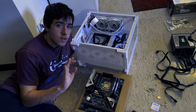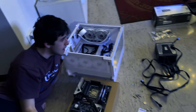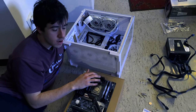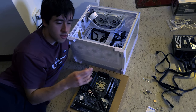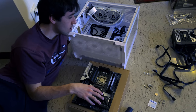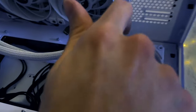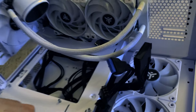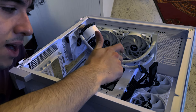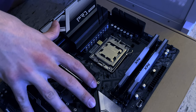Okay guys, so we don't have good news. What happened is, as you can see, we dismounted the whole PC and I tested with another power supply because I thought, okay, maybe it was just the power supply that's broken, but when I first turned it on, the motherboard flashed its LEDs and now the motherboard does not boot. So we got a power supply tester and we are testing the fans that are hooked up to the power supply, and the power supply doesn't work. So in short, our power supply is broken, and being broken, it shorted our motherboard, and now the motherboard is dead. So yes.